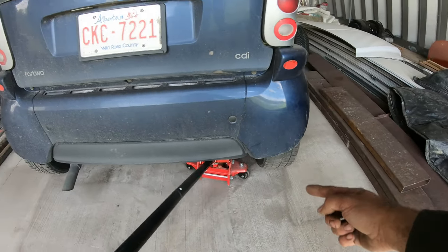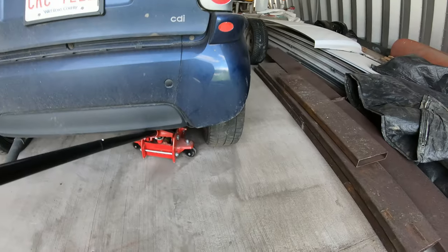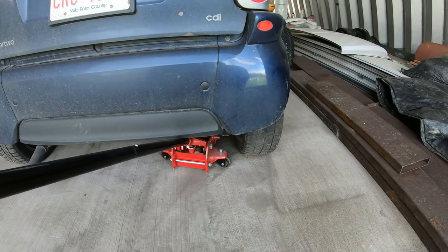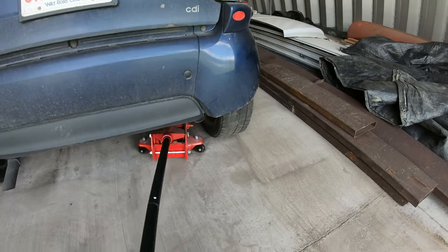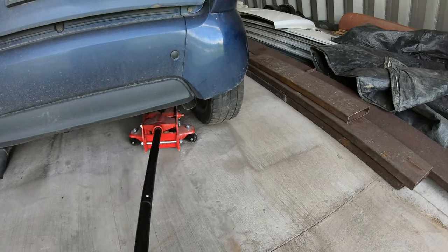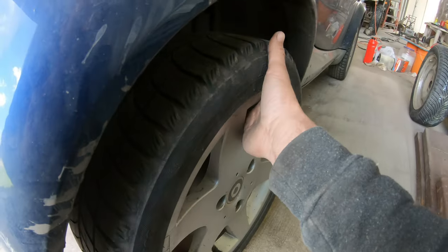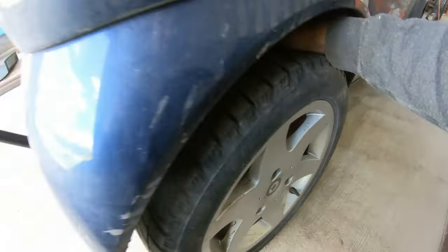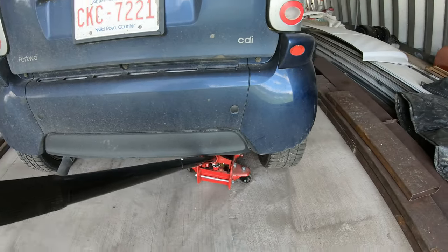The passenger side is wearing on the inside, the driver's side is wearing on the outside. I brought it in because I thought maybe the axle bearing was going on the passenger side, but I jacked it up and everything is nice and tight — nothing going on there. The bearing is still good.